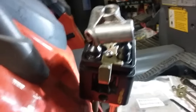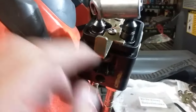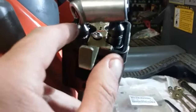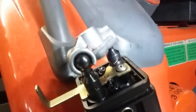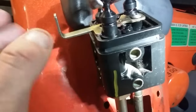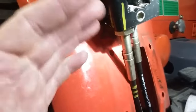Put your allen back in, and from there adjust your cables back down to where your lock — which used to face the rear toward the fender — locks both of these cables so you can't hit it inadvertently. You just end up adjusting your cables back down to where your lock sits properly in that groove, then tighten your lock nuts and go from there.